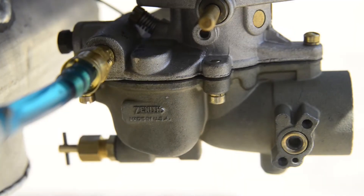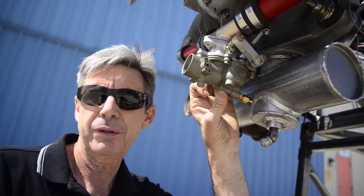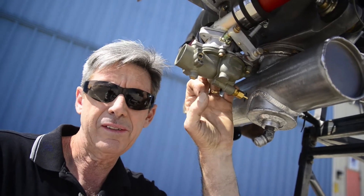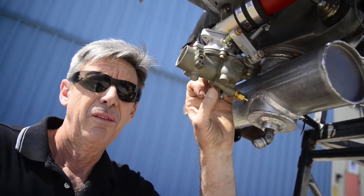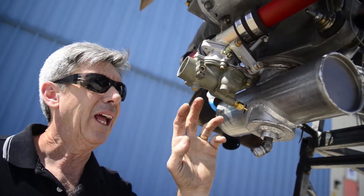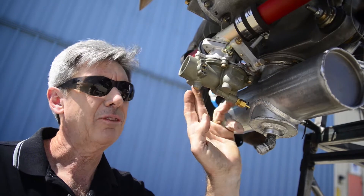Moving to the carburetor — the carburetor I decided to use is a Zenith Bendix carburetor, the largest Model 68 that they make, with a Venturi size of 28 millimeters. This is the same carburetor I had excellent luck with on the Cracker Jack back in the 80s on the DAF engine. The DAF engine is only 950 cc's and this engine is 1,600 cc's, but the DAF ran at 4,000 RPM and this one runs in the 2,900 range, so it calculates out at about the same cubic feet per minute. But as you'll see in the videos, the carburetor is a little bit small — I'm only getting about 28 inches of manifold pressure and we'd really like to see 29 at full throttle.